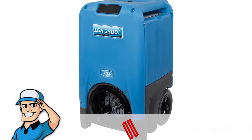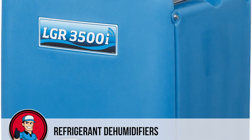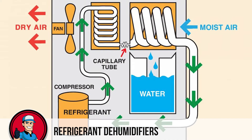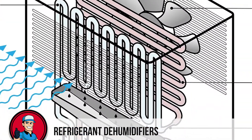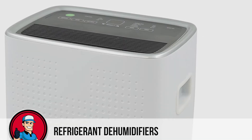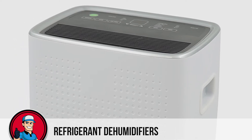Let's talk about refrigerant dehumidifiers. The coils inside the refrigerant dehumidifier are cooler than the air around them. When the air passes through these coils, it becomes colder and its ability to retain and hold moisture falls. Water condenses on the coils and drips into a bucket or pan for disposal. The now-cooled air flows back over the warm dehumidifier motor so that it is slightly reheated before being released back into the room. This warm air going out of the dehumidifier is dry, which is more likely to attract moisture and maximize the dehumidifier's efficiency.